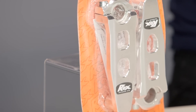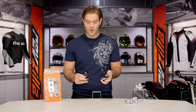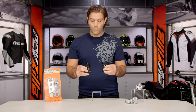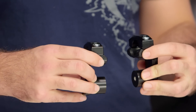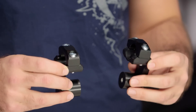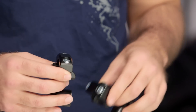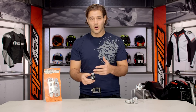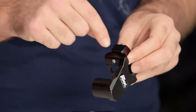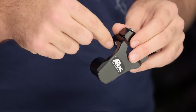Overall, I think it's a great product — really well made and well designed. I wish they would have created some kind of bracing component so that once you had the two risers installed, they weren't acting separately, especially in the adventure and dirt market where you're going to be crashing and bars can be twisting. I would like to see a bolt-on component that locks the two risers together, allowing them to flex in unison. Also, with the shorter risers specifically, you're going to have a little bit of a problem with install because you're going to have to get an Allen wrench in there to tighten it down — you may have to chop and modify an Allen wrench to make everything work.